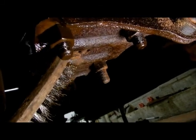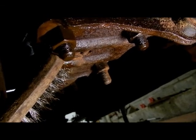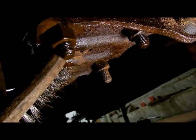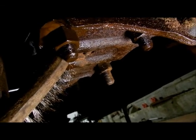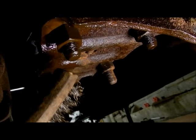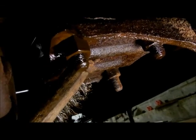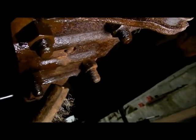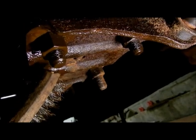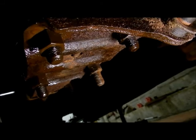We're going to run it the old ten turns down, stop, hit it with your oil — I like to use croil. Then we're going to go back and tighten it, keeping going up and down and hitting it with oil as we go, which will help clean the threads. By the time we're done, this thing will spin on and off nice and easy. That's what you want so that when it comes time to remove the saddle from the spring, these are not going to pose any threat. You can run them all down to the bottom and spin them off.